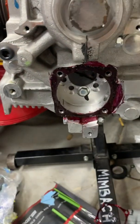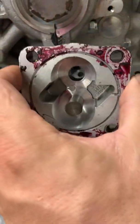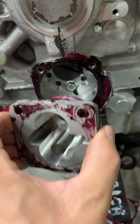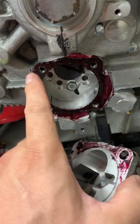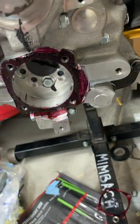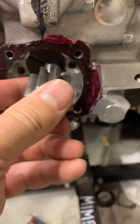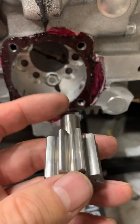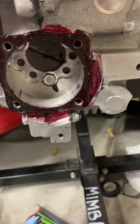Going forward, we're going to clean this off — it has sealant all over it. Make sure you look at your cam right there to get an idea of where it is. You'll tap this in gently with a mallet. I've already got the gasket on there with gasket sealer on the block on both sides of the gasket. Then I'll clean this up, put a little bit around the edges, tap it in gently, and line this slot right here up with the slot on the cam. There's a mark here that corresponds with alignment — having that slot straight makes it a little easier when you're in there.